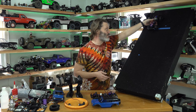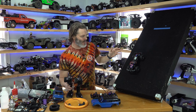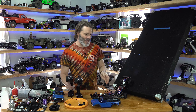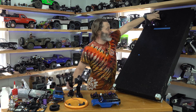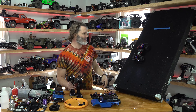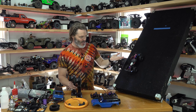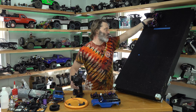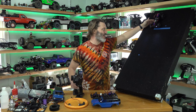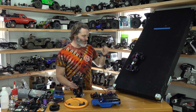As you can see, when we're rolling backwards it's more full drag brake. But if I tap backwards, then it starts rolling backwards at a higher rate. Now we go back to forwards in Mode 2, and now we've got the full drag brake in the forward direction. Really perplexing to me. So if I tap forwards, now we have the reduced drag brake — still not a complete free roll, but it's just odd. So if I tap reverse, now suddenly we get more drag brake in Mode 2.